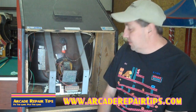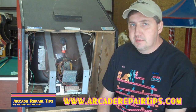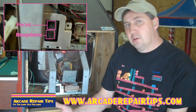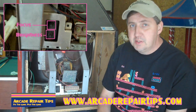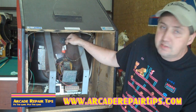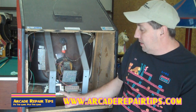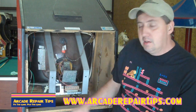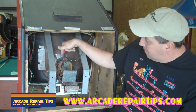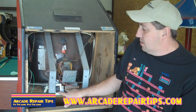So this monitor was out of focus. Now we're at the back of the game. Although there are many different types of monitors and chassis, one thing is pretty constant: the focus and the brightness are on the flyback. Now if you've watched our other video series, you probably know what the flyback is. This usually says 'high voltage' and attaches to the flyback. On the back of the flyback — ours is on the back of the game, yours may be on the side or kind of hard to spot — follow your anode cup, the big long red wire that goes to the tube and comes back down to the flyback. On the top is the focus; the bottom is the brightness.